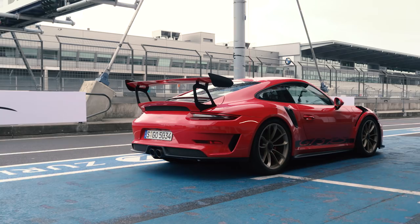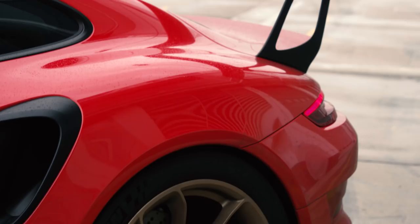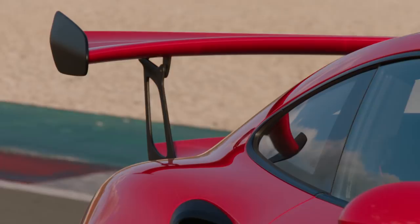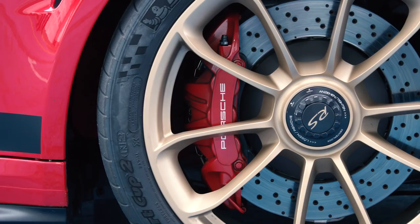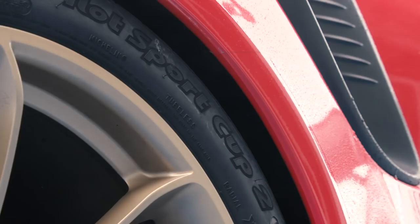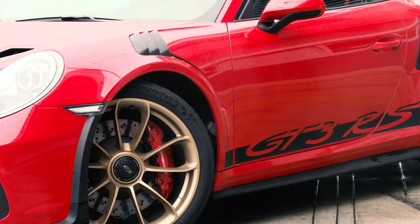The rear wing is larger than the last GT3 RS's and it gets what they call 3D end plates. Like the end plates on an aeroplane wing, they help maintain pressure over the wing itself. So aerodynamically, this car is more efficient than a cup car — it generates almost as much downforce but much less drag. The wheels and tyres are the same as on a GT2 RS, apart from the rear tyre compound and the fact that the wheels say GT3 RS on the rim. Magnesium rims aren't available this year because production is limited and they're all allocated to GT2 RS's with a Weissach pack.